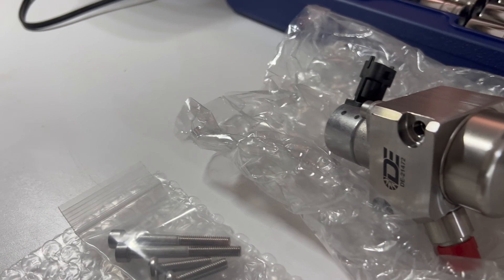The TU fuel pump is a solid option for anyone wanting to stick with the stock B58 turbo and run maybe an E30 or E50 mix at most. It can still get you into a Stage 2 Plus tune and can run ethanol mixes as well. But personally, if I'm going to spend money on a TU pump, I might as well spend a little extra for the Dorch Stage 2 fuel pump — it runs within the same parameters as the B58 Gen 1 fueling system, so no issues with the fail-safe or pressure relief valve, and you have more room to grow in horsepower down the line. That's why the Dorch Engineering fuel pumps are really good options — high quality pieces of equipment.